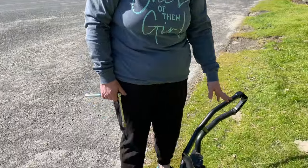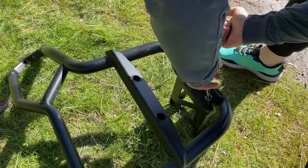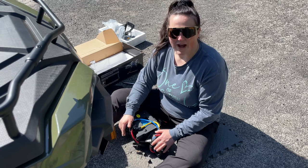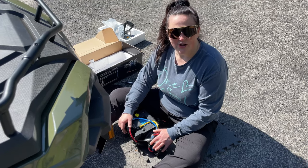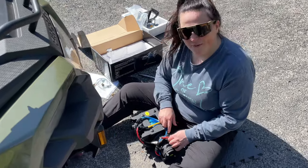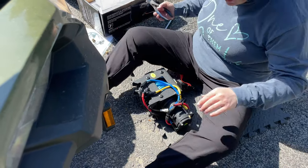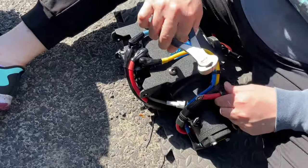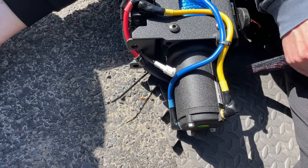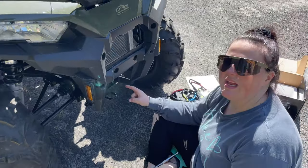We're now going to remove the last two bolts in this cradle here. Now we're just going to make sure all the wires are ran correctly and it's all good to go for install. We're just going to cut this zip tie here — don't cut any wires, just the zip tie — to break this loose, and then unravel it. We're good to go. We need to remove this plastic trim before putting in the winch.